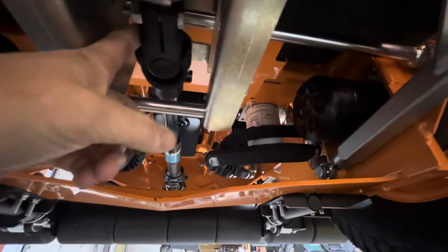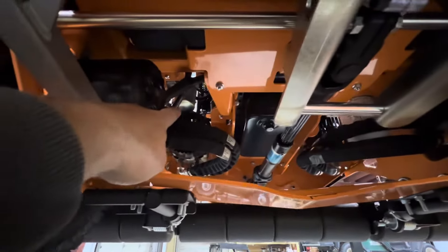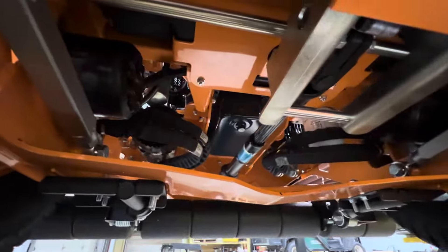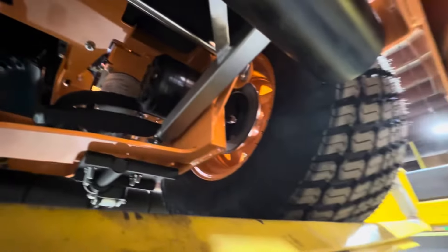You've got your hydro filters underneath here, the drive shaft, and there are grease zerks on these U-joints and on the spline. You can see the pumps back there with the big fans on them. Oil drain is obviously there for the diesel motor. You can also see the disc brakes in there — it's a disc brake machine with a foot pedal.